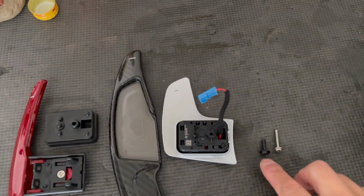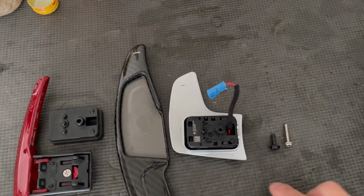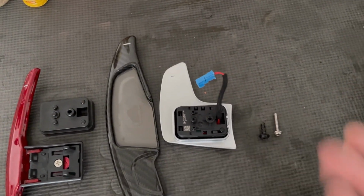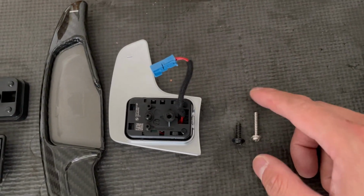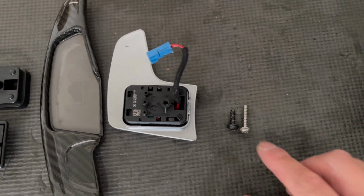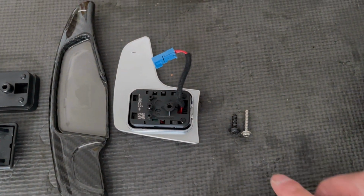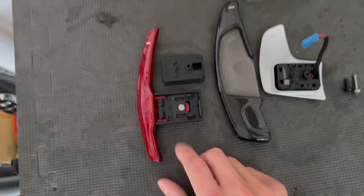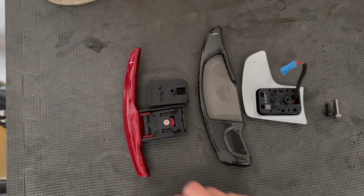All right, so it's super simple. Take out your OEM paddle shifter. This is a little fastener right here. Undo that clip, bing bong, it's out. And that's what I was saying, with your fastener, you're going to need this longer one right here that Shifter CA had to send out to me. So here's your Rexpeed extension right there, and here is your Shifter CA paddle shifter.